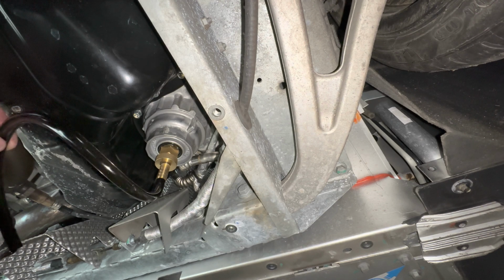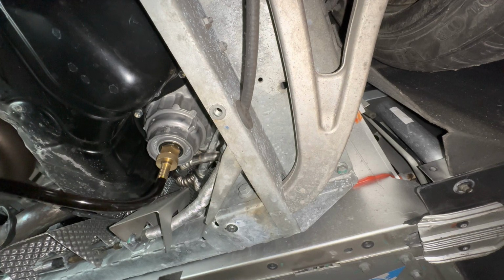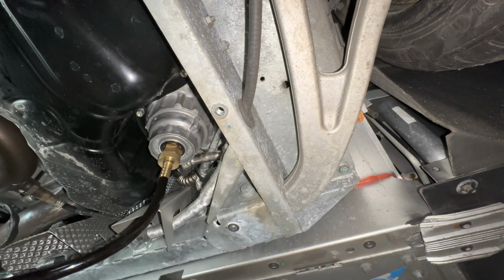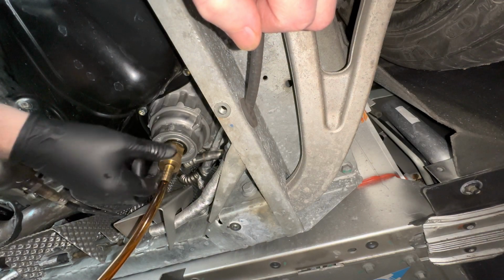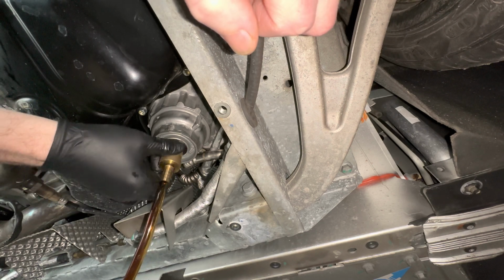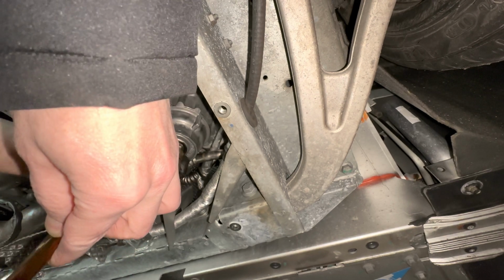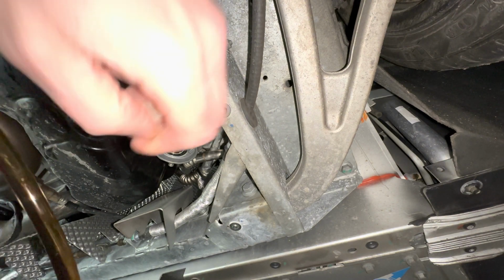So you can see that the oil is now draining right into the pan. So it's going to alleviate a mess. Hopefully you can see this. Okay, so we'll let this drain until this part gets pretty clear. Okay, so I think it's pretty much drained, so I opened this valve so the pressure is not pushing in, releasing oil. So now we'll take this off. Hopefully most of the oil's out. Let's see. We'll see if most of the oil came out when we take off the filter housing. Okay, let's move on.